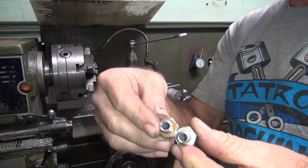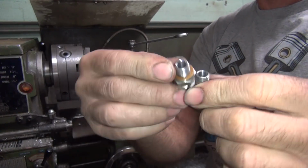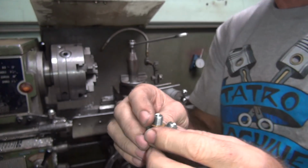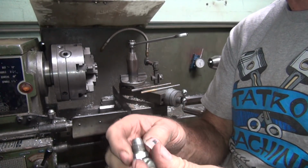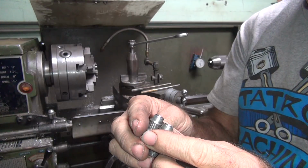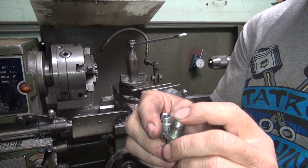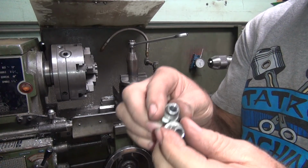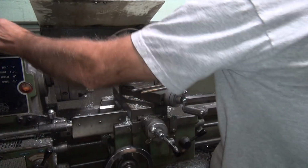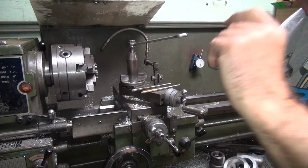So there you go. Now it's like the other one. Big all the way through. That'll increase the oil pressure, I bet, by probably 3 to 5 pounds, just doing that. They're a very restrictive oil system. If you do anything to make it flow more oil, it gets more oil pressure and volume. Alright, I'm going to clean those off. We'll be done.